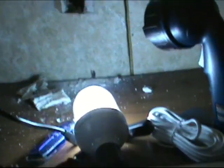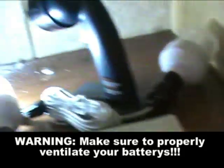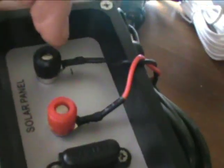I'm in the house, and I am drilling out the holes that we're going to need for the discharge of the battery, in case they overheat or discharge any gas as they're charging — that will go out. I'm going to run the tube up around here and out. What I've got going on right now is this wire here coming out from right there, and that's going to meet up with the three-way plug off the solar panels outside. That comes in to this charge controller, and I'm using one of the bulbs at the moment to light the way. The wiring will come in from outside from the panels — from the three-way — on this cord right here to where it says 'solar panel.' We're going to hook up our negative and positive. Red is positive, black is negative.